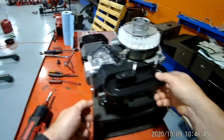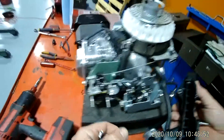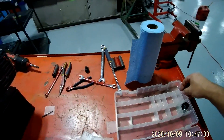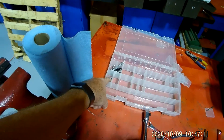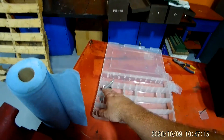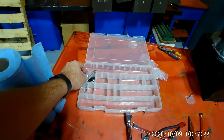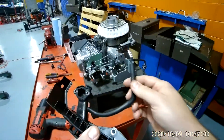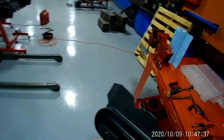It takes that off and this thing should just pull off easily. We have some kind of air tube connected to it right there. Take these nuts and bolts and store them. If you want, write down on a piece of paper 'air filter assembly bolts' and put it in there with them. Then put all the bolts and nuts with a piece of paper labeling the top cover, gas tank, and all that stuff — that wouldn't be a bad idea. If this hose is sticking on there real tight, you may have to use a pair of slip joint pliers to twist it off gently.